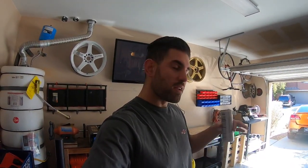The car is driving okay but it's a little bouncy. The mag ride is fully active — switching between touring, sport, and performance you can definitely feel a difference. Over bumps it's very firm on the downstroke but the upstroke is like a long float, which makes me think something isn't connected and we need a zero-point calibration. I already spoke to my friend at Finley Chevrolet — gonna get an appointment for alignment, zero-point calibration, and a radio update.